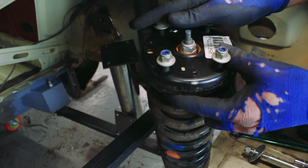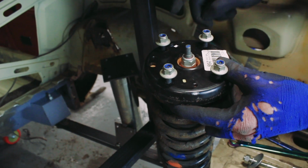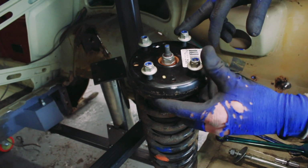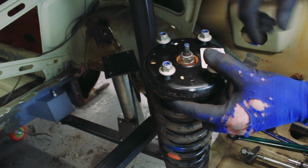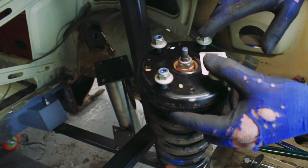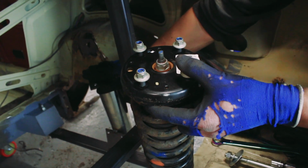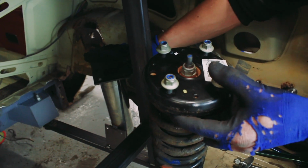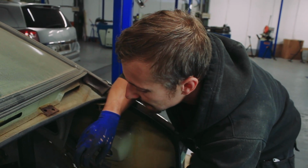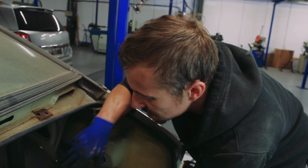So that is essentially mimicking the top position of the shock absorber, and it's really important to get this position correct, because if we don't, we're not going to have anywhere near the right suspension geometry. We're doing this the easy way by copying it all off the Jag, really. We are obviously making slight changes, but nothing drastic, and this is one of the things you don't really want to change. I could make the car a bit lower by changing the height of this. If I started fabricating this an inch up, the car would be an inch lower down, but that actually affects quite a lot of things. So we don't want to do that. We want to keep it easy, and we want to make a nice road car, and that's what this will be, by replicating that same position.